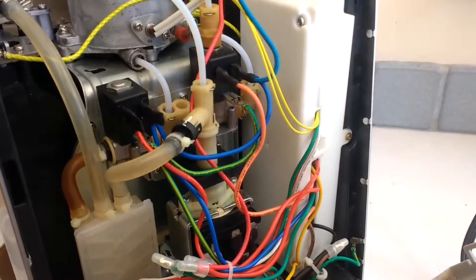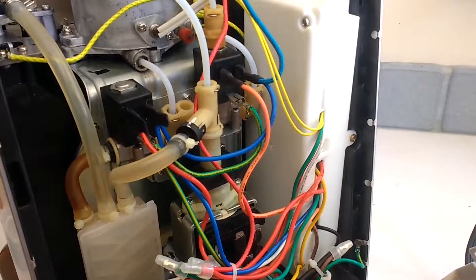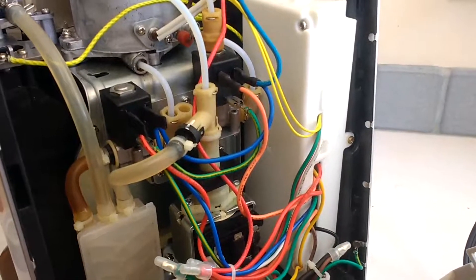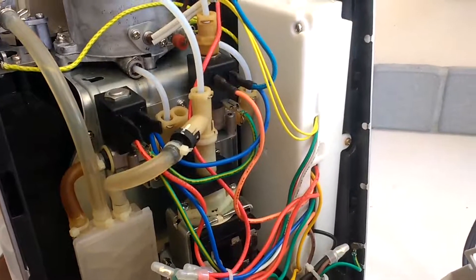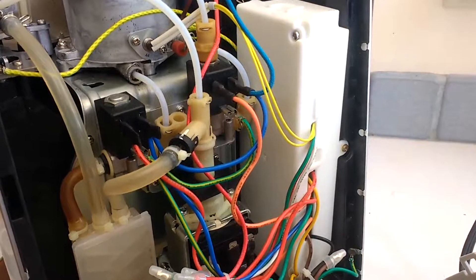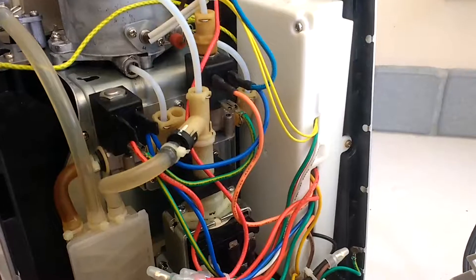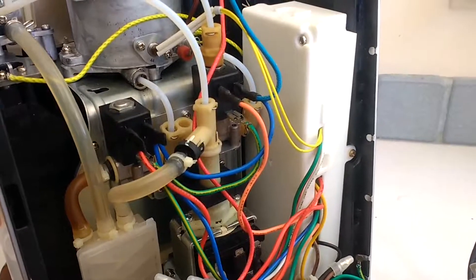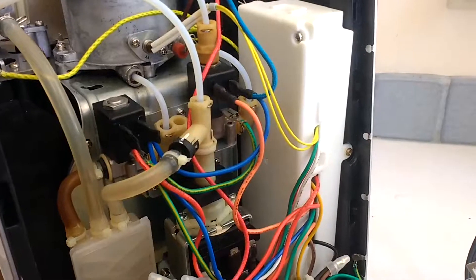Changing the vinegar before I went to bed after having soaked it already for several hours. That apparently removed some gunk and loosened up the valves. Putting it back together today, I am now getting water through the brew head. I'm real pleased. That valve assembly, apparently, is no longer sold by Breville at the parts replacement depot. If you look online, it says discontinued. I don't know if aftermarket solenoid valves are available. Fortunately, so far, I do not need to make that inquiry.